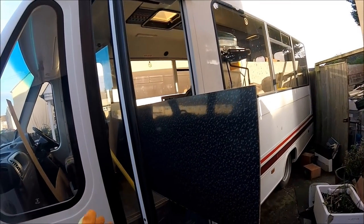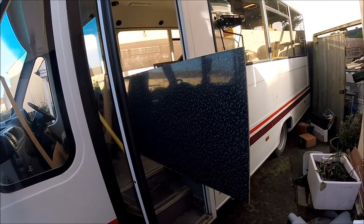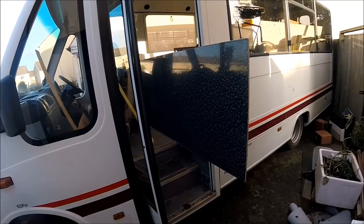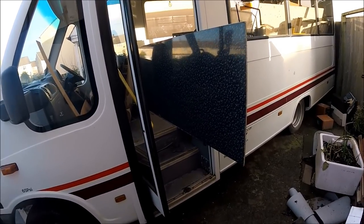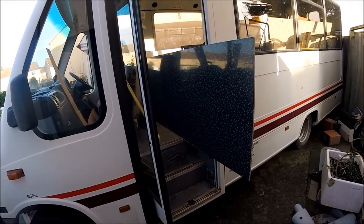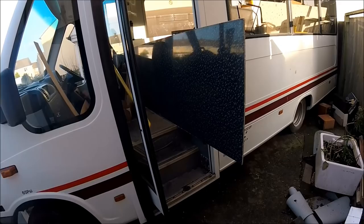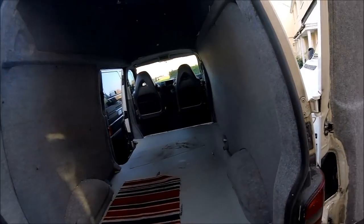I don't have a specific template for the Smev, so I'm going to do what I did the last time that I built a kitchen unit for a Smev unit. And that's basically just to use the cardboard box that the unit came in, cut all the way around that and all the way around to the point where the hob unit fits through it, and that then creates a template for you. So there's going to be plenty to be cracking on with as well.